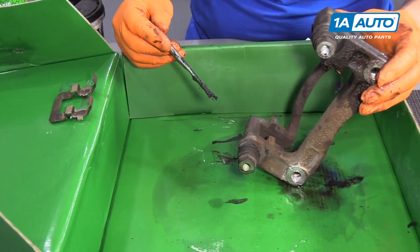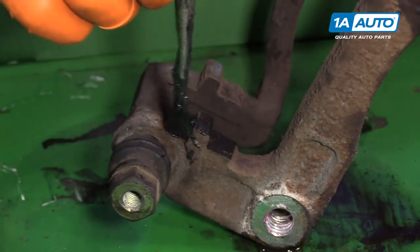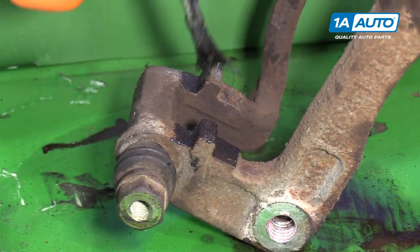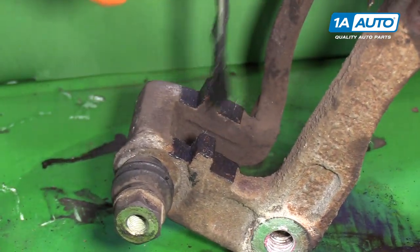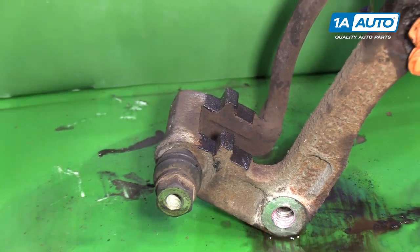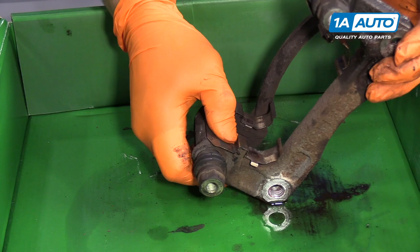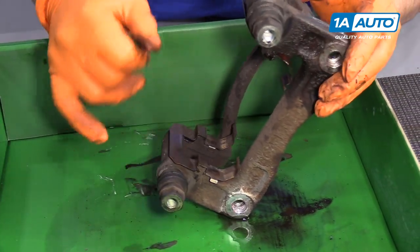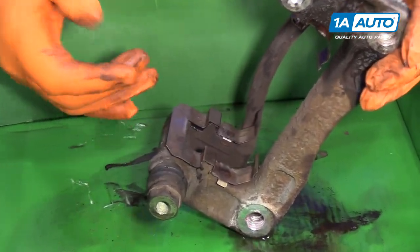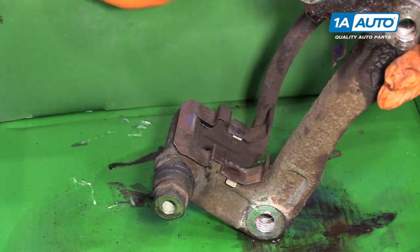Before I put the caliper tin back on, I put a little bit of that caliper grease underneath. This assures it won't get rusty and swell up and push that pad on tight and freeze it on the bracket. You do not want to put any grease on the upside, for it will collect road dirt and pad dust and stop that pad from sliding back and forth.